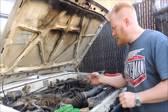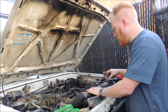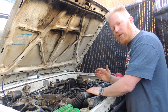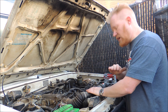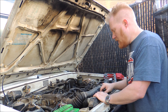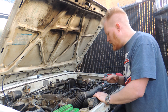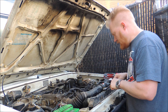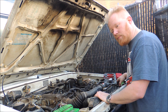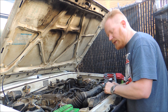This right here is my 1986 Toyota Motorhome. Over the last couple of years, the last couple of times I've driven it — I drive it across country in 10 to 15 hour stints — it's been losing a little bit of coolant. I don't see a noticeable leak anywhere, but it's been eating what's in the reservoir. I took the reservoir out and made sure it wasn't leaking, but the coolant is just dropping a little bit.